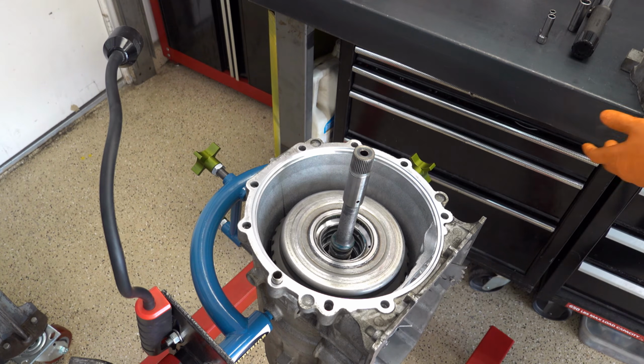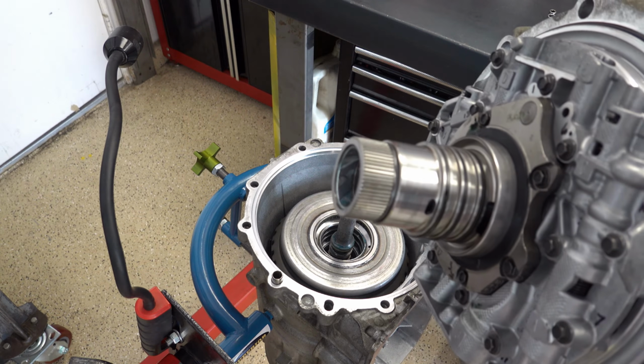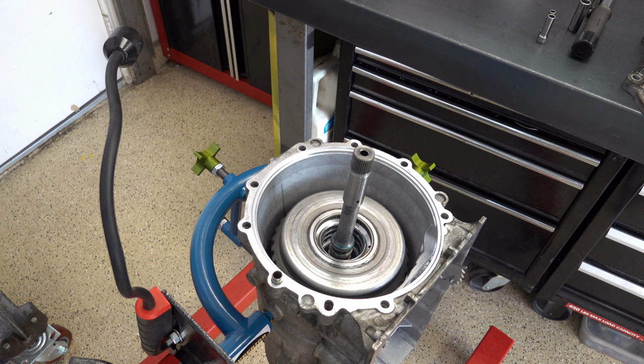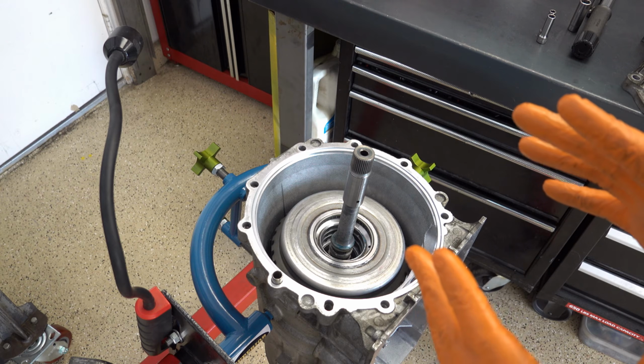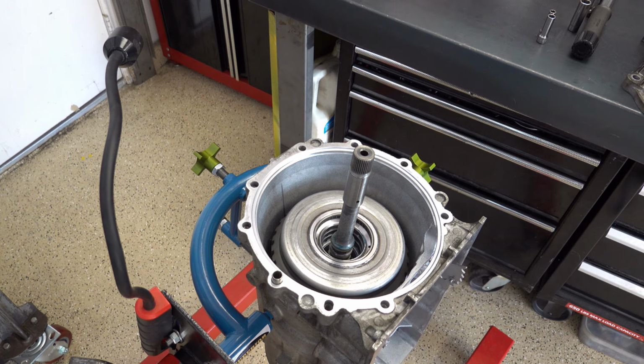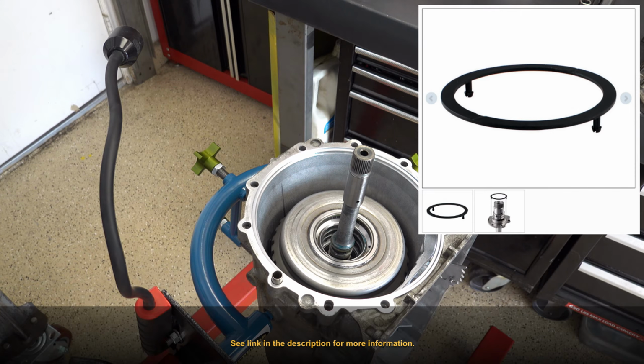Third thing I'll cover, I know I said a couple, but I guess there's a few. Third thing is this pump thrust washer here on the base of the stator. This washer is not selective. In other words, unlike a 4L60 or a 4L80E, you can't go to GM or your transmission part supplier and get different thicknesses of washer to adjust your end play. There's just one thickness. When you machine the two halves of the pump assembly, you're effectively shrinking the height of that pump assembly, as measured vertically, by 20 thousandths of an inch. Standard practice is to take 10 thousandths off of the face of the working surface on the body and 10 thousandths off of the face of the pump cover. So obviously you have to make that up somehow. The way that you do that is to purchase Sonnax's 20 thousandths thicker pump washer, so that you can preserve that relationship between the travel on the front of the drum and the pump washer.